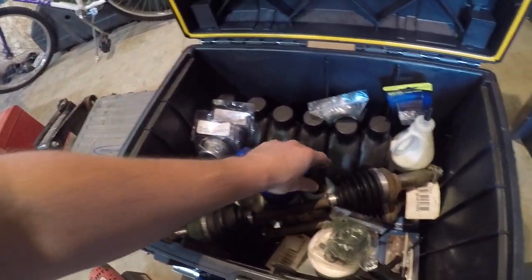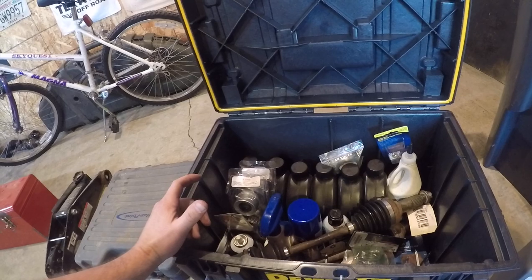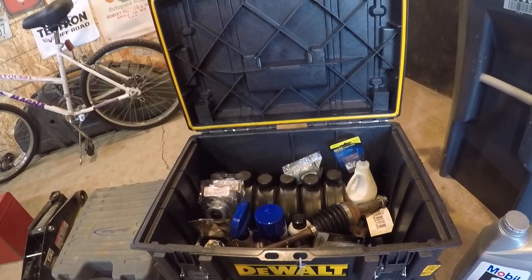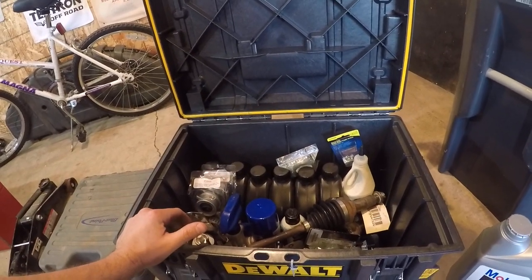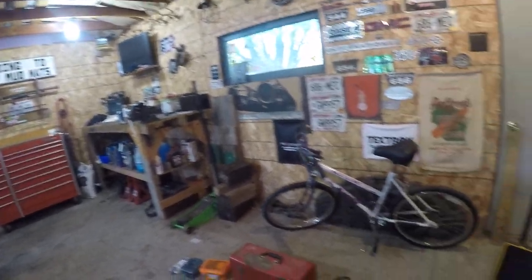You bring PB Blaster, a can of brake cleaner. I always spray white lithium grease at night when I get done riding. I always bring enough oil — this is just cheap 5W-30. If I swamp the Grizzly, I'll do three oil changes, and then put Mobil One 5W-30 synthetic back in. I've swamped that thing three times and it still doesn't smoke at all. You shut it down right away, change oil three times, change the filter twice, then throw 5W-30 back in — that's the fourth oil change. I've also used Lucas Oil Stabilizer — stuff's like honey — but I do add that every once in a while just because I've swamped, and it creates a film on your internals, just keeps the dry starts down.